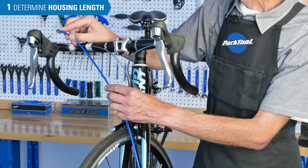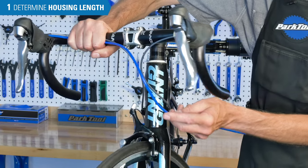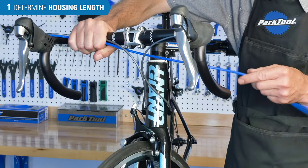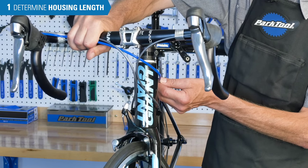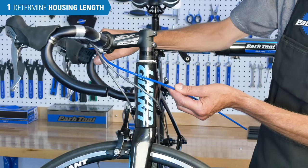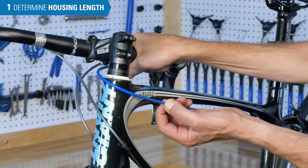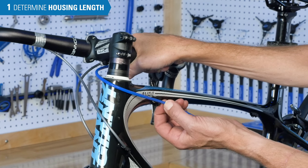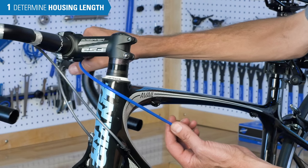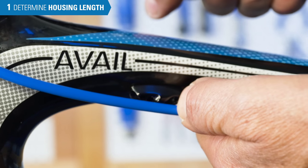For the right lever, roll back the hood and insert the housing fully inside. Again, hold with your hand where the handlebar tape would end, and pay attention to routing. Coming around the front is a bit awkward; coming behind is a much more natural line, so we'll come behind in this case. We don't want it any longer than we need. Gently rotate the bike all the way to the right and pull the housing to find where the cut point would be — it will never need more than right there. If it's shorter, it would bind and be a problem when packing the bike or crashing. Gently let it roll over, find your cut point right where it stops.